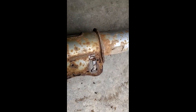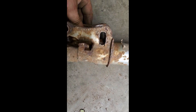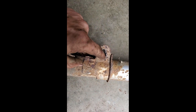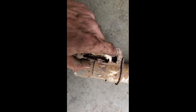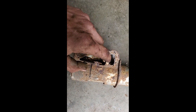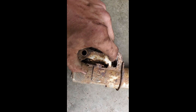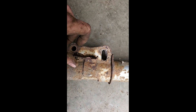They want you to slot the strut out so that you have some room for camber adjustment later. The way I did it was I took a drill bit and drilled a hole closer to the inside of the strut, then took a zip disc and zipped out what I couldn't get with the drill bit, and then used a carbide bit to make it nicely slotted and take out all the burrs so the bolt can slide back and forth for camber adjustment.